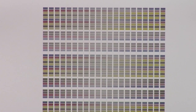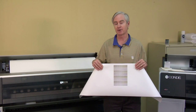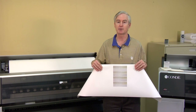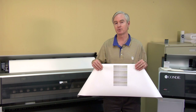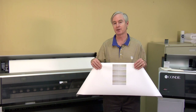Another point to remember: I recommend that you do a firmware check on the printer before you do an alignment, to verify that the firmware is up to date. I suspect if you upgrade the firmware in the printer it could change some print characteristic. So it's always best right before the alignment check — like in my other tips — that you do a firmware check both for the printer and the network card.